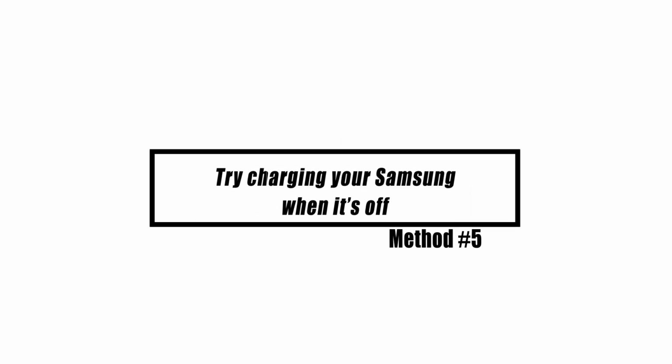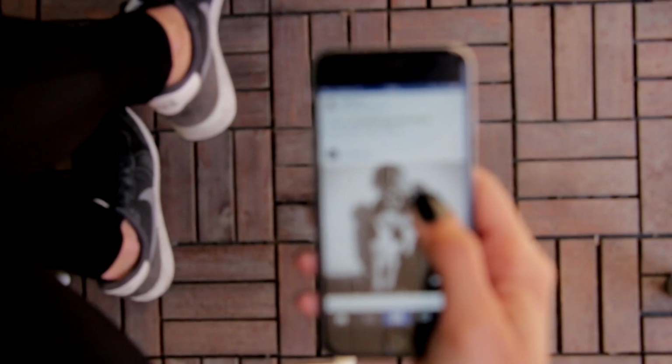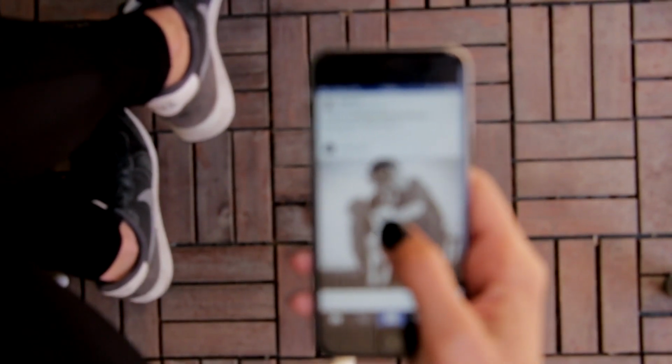Users of Samsung Galaxy devices have had success shutting off their devices while charging in order to resolve the moisture detected issue. If you haven't given it a go yet, now is the time. Let the phone charge for at least 30 minutes before using it again. Turn it back on and use it normally thereafter. There is a good chance that the problem is transient and was caused by a software fault if the error doesn't reappear.